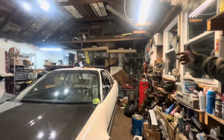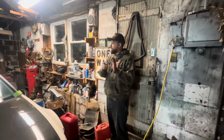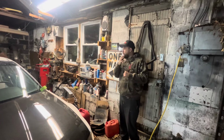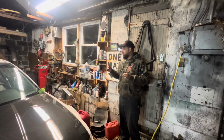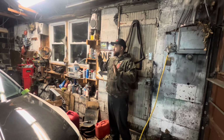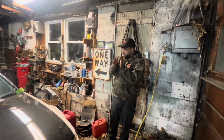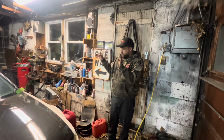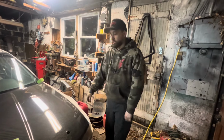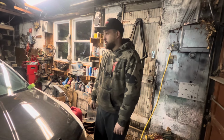But I'm going to pull in the trailing arms just a little bit, because I did put them out 2 inches on each side, which is what you're allowed to use. But for this car, as much as I'd like to extend it as far as I can, just the way the bumper is set up, I'm going to suck it in a little bit so it can clear the bumper and we don't have to worry about it. It'll still be extended, so we'll still get the wheelbase. But there's not a lot left.